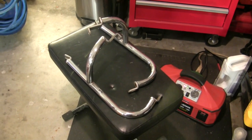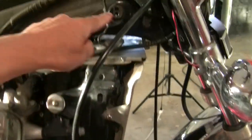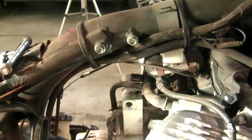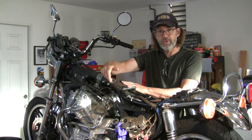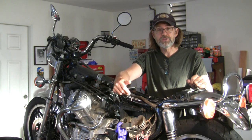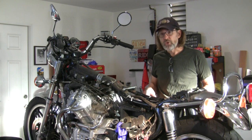One of the first things I had to do to get the carbs out easily was take off the engine guards. Most CX500s won't have these, but I took them off. Other things done in previous videos that are part of engine removal: remove the fuel tank — first turn the fuel valve off and disconnect your fuel lines. Remove the seat and the side covers. Disconnect your battery starting with the negative terminal first, then the positive. And drain the oil from the engine.